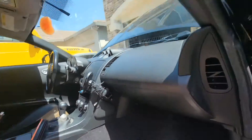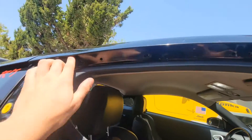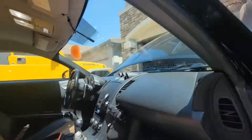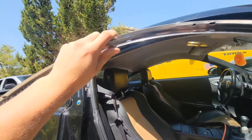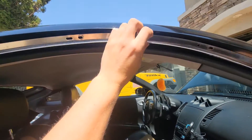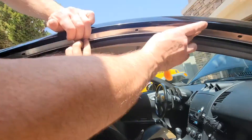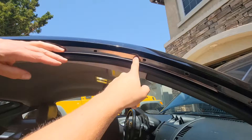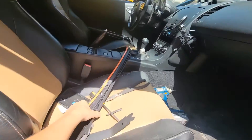I'm going to get a new swab and get the rest all the way down to here. So now it's all kind of clean and smooth — no more adhesive. This is ready to be stuck into the trim piece. Next you just want to re-bolt this — there are holes that will align it with these tabs right here. We're leaving the old pops out because ours were bad. If you want to put yours back in, go for it. We're just going to put all eight bolts back in, and then we'll show you how this lines up.